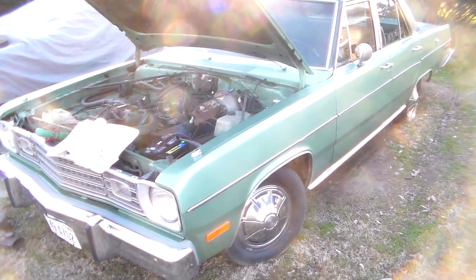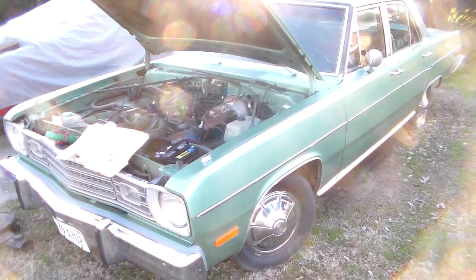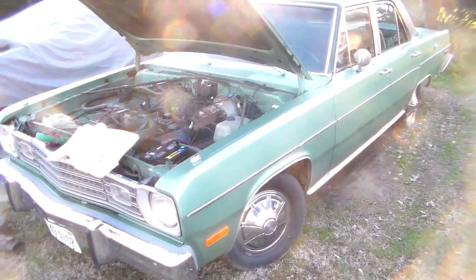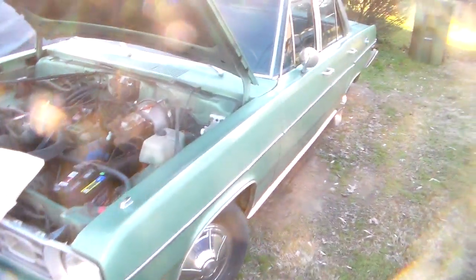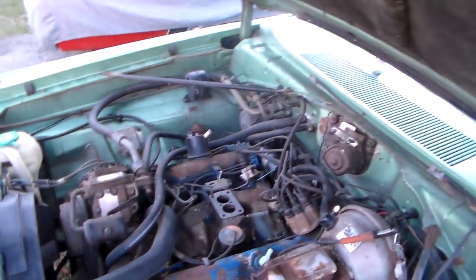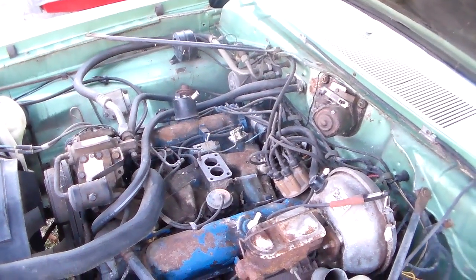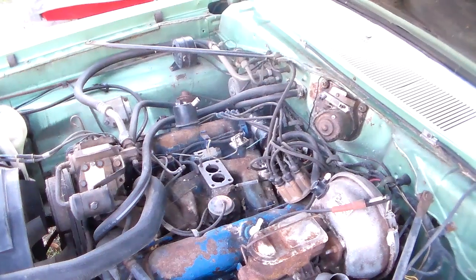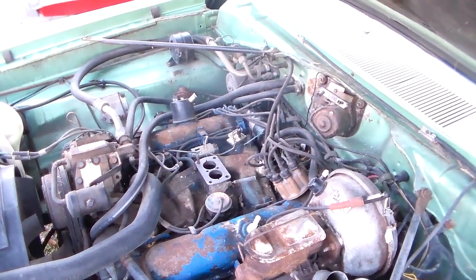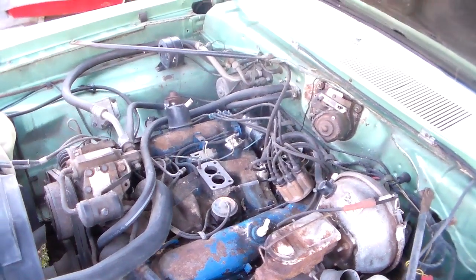I was told it had an ignition system failure of some sort, and I'm intimately familiar with the ignition systems on these cars, so that's what I'm doing right now. I've got the carburetor off of it. I was told the carburetor had been rebuilt and overhauled, but judging from the looks of it and the smell of the gas in the tank, I thought it'd be a better idea to just go ahead and take it off and go through it again. It was full of junk and crud. I'm not even totally sure the carburetor is going to work, but I'm doing the best I can with it.